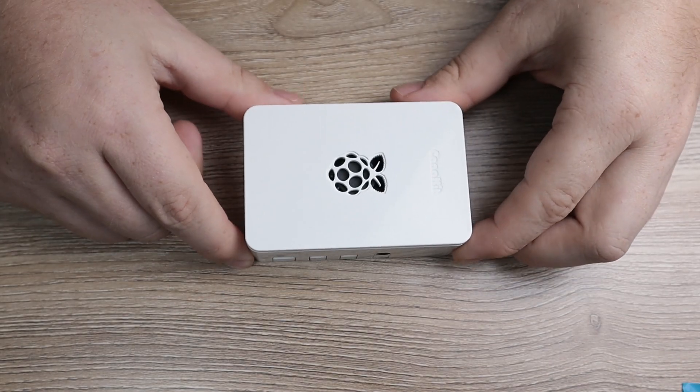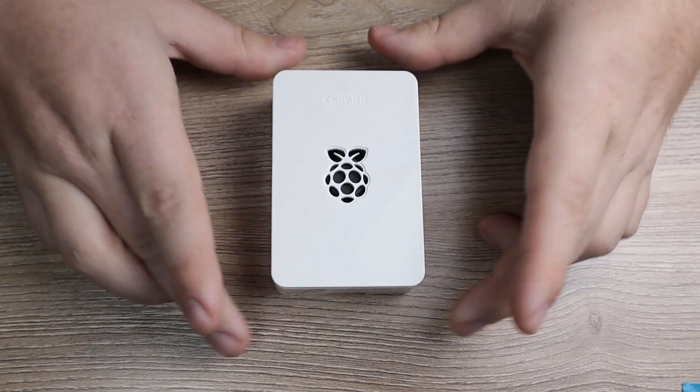Now our Raspberry Pi is ready to use and it should have fairly decent thermal performance. Once I did get these heatsinks and this fan installed I went ahead and loaded up the ARM version of Pop OS — I'm going to be doing a separate video on that so make sure you are subscribed and ring that bell. What I did to actually measure these thermals is I ran Geekbench for the time it takes — anywhere from 6 to 10 minutes — and I got the temperature of the CPU right after the test was completed.